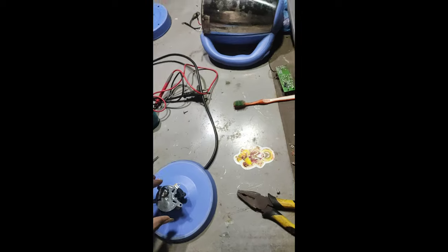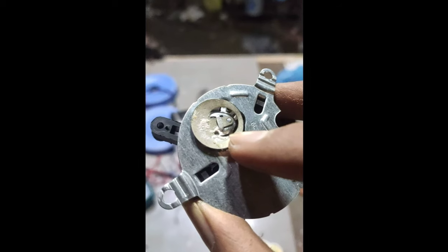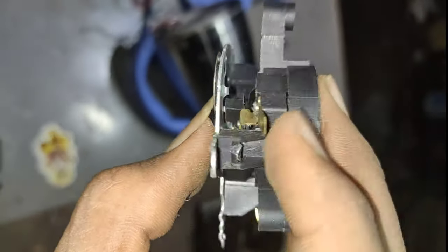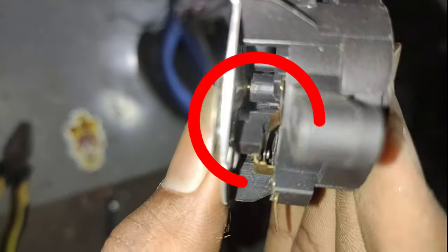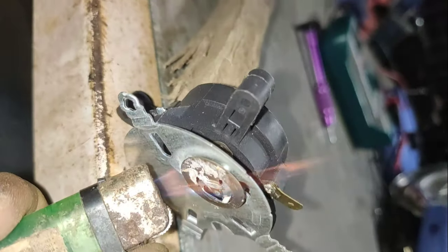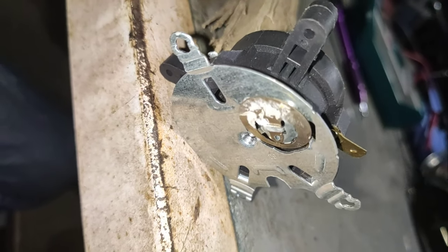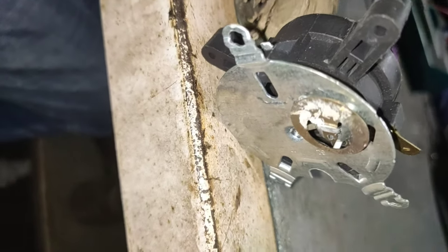The main connector which connects to its base for power has that built-in failsafe mechanism, and you can't see it easily unless you do a pretty heavy teardown. It has that same metal piece we saw in the switch, which in normal operation stays on, but it pushes to disconnect the power if the temperature exceeds its threshold. But unlike the switch, it has direct contact with the metal body and doesn't rely on other agents for switching. You can see the switch terminals, which are normally closed, but when that metal piece heats up it pushes a white rod and disconnects the terminals. It keeps power disconnected until the base is cooled down again. This is the failsafe mechanism which saves the kettle from going red hot if you accidentally run it without water.